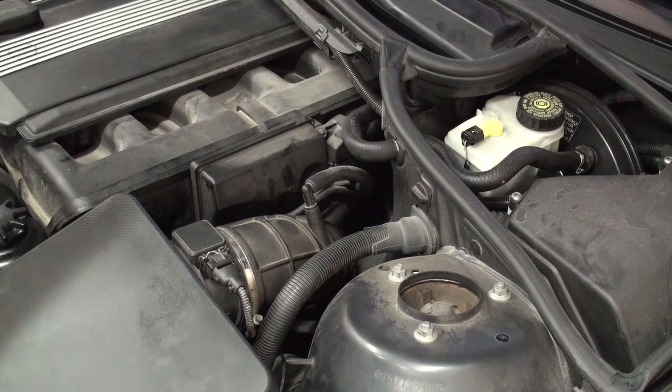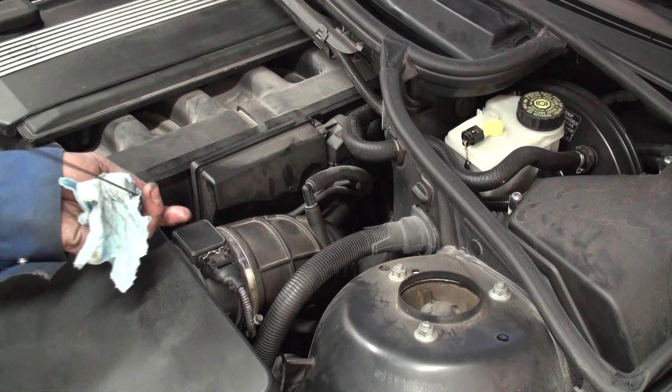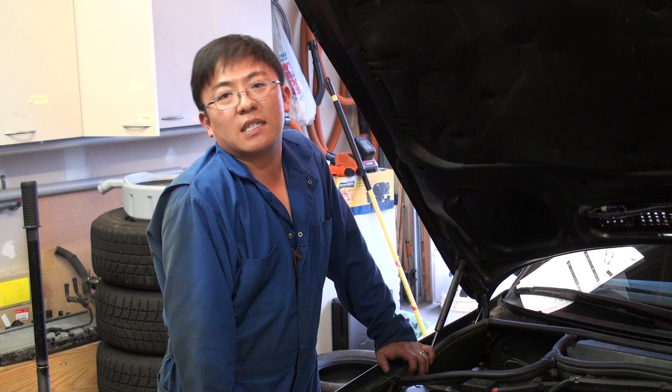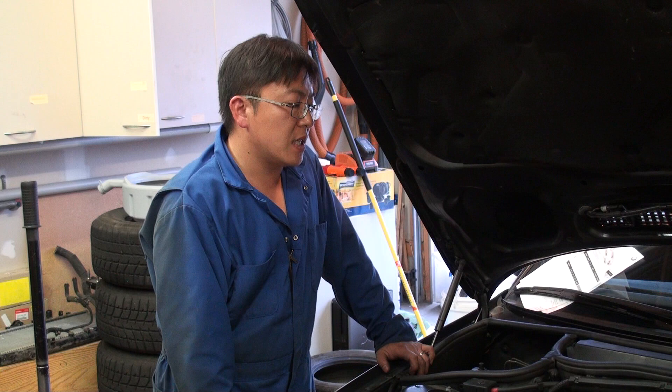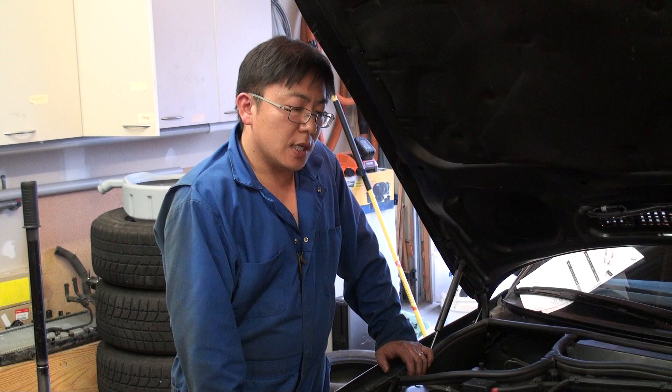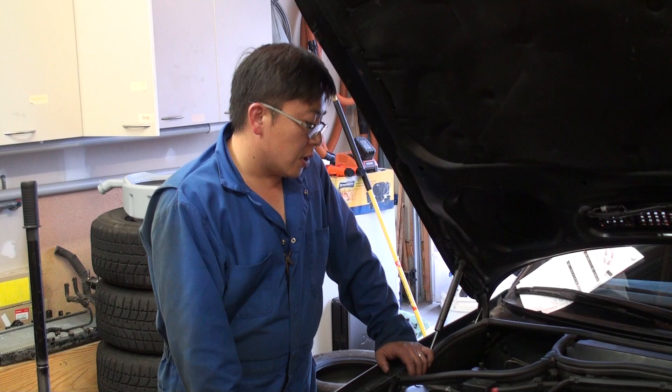As you can tell, it's full. Doing an engine oil change on a BMW 3 Series E46 chassis vehicle is not overly difficult nor time consuming, and can be very rewarding because of the amount of money you save, as well as having the peace of mind that you did the work yourself and did it properly. All in all, I ended up using just over seven litres of oil on this engine. I purchased the original filter, crush washer, and gasket assembly from BMW, as well as the German spec oil from a local car parts dealer. I hope you found this video useful and informative — rate, comment and subscribe. Thank you.